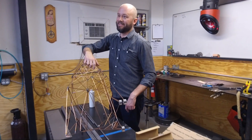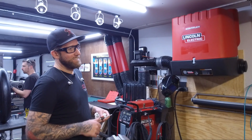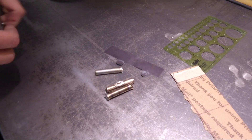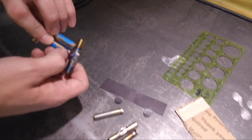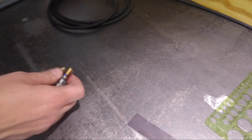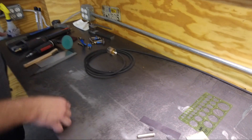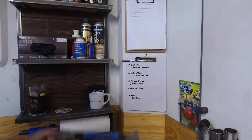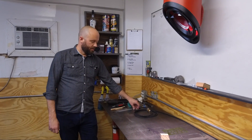He looks a little nervous. Brandon has been doing test welds and breaking them apart using our press, and then got to some he was happier with. One of the unique things is the heat discoloration that happens with titanium when you start to get it hot — someone told me it's not supposed to discolor, that it means you've gotten to the wrong temperature. Also, this is titanium-only equipment — if he were to use these same bits and blade on aluminum or steel, it would contaminate the welds or the pieces.